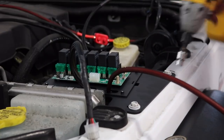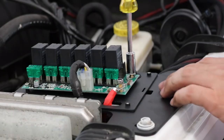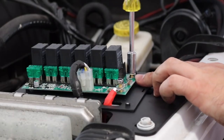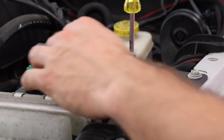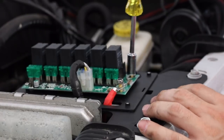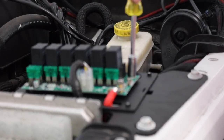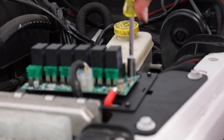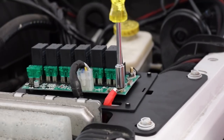Once we have them through, we're going to attach this onto the bolts where we took it off and tighten it back down. You want to put the black on the GND and the red on the VIN, and then plug in the wire harness for the switches into its location. Then we can connect this up to the battery, hook some accessories up, and see how it works.